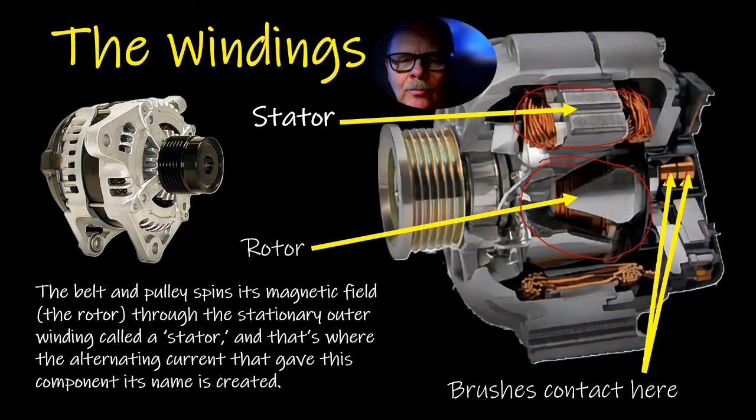I had a motorhome come in there, and it was putting out normally until you gave it a little gas, and then it would peg out and put out too much. I replaced the voltage regulator, but it turned out on that one, centrifugal force inside the alternator as you picked up speed was causing it to full field itself. That's the only time I ever saw that. After replacing the voltage regulator, I had to go back and replace the whole alternator.